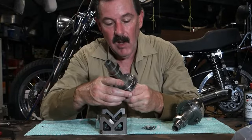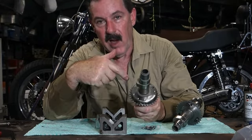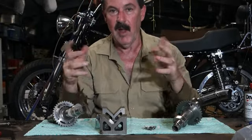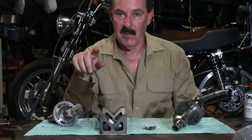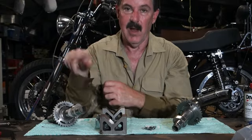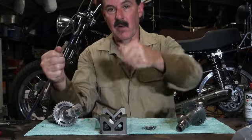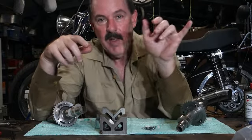together when I thought to myself, when it was in the engine and I was turning it over by hand, using the degree wheel as a crank, right? You can't use the nut on the left side of the crankshaft because it has a right-hand thread on it. So as you turn the motor over in the direction of rotation, you're actually undoing the nut. If they put a left-hand thread on that, like some bikes have, that'd be great. But they didn't. So I'm using the degree wheel as a crank handle like this, and my engine is rephased.